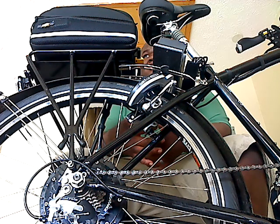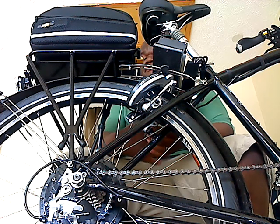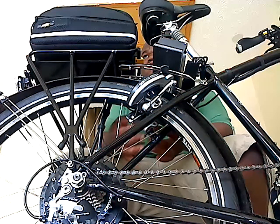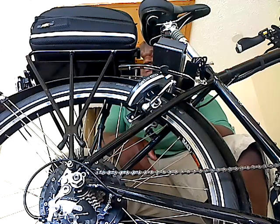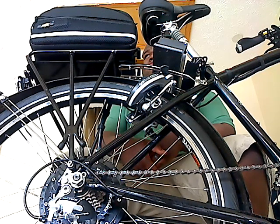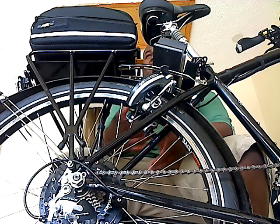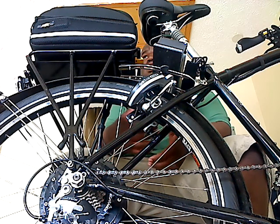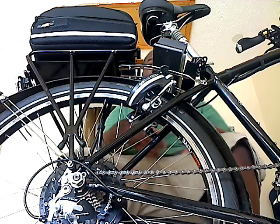But I also see it whenever I'm accelerating, and this controller can peak up to like 50, sometimes 60 amps momentarily under load, and then it kind of throttles back down to around 35, 40 amps. The shunt has been modded on this controller, but also since I modified the shunt, as the weather has gotten warmer, my current limit has gotten higher, so I also think there may be a current feedback issue with the controller, where the controller is having a problem possibly clamping down on the phase current or something like that. I don't know, it's just speculation, but let me just go ahead and show this issue.